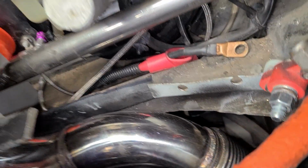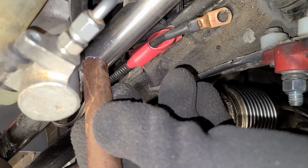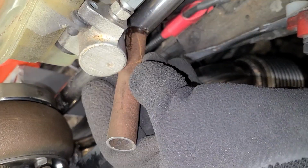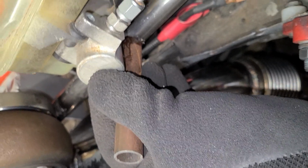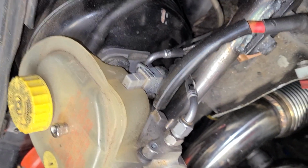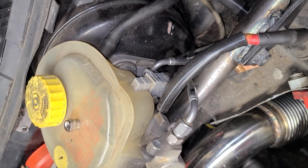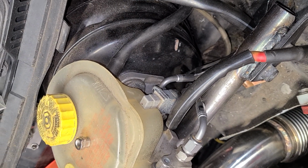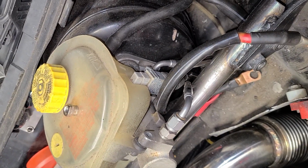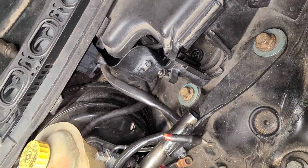And then I realized while I was at it, since the brake booster tends to flex a lot on this car, you know me already, I'm going to weld a tube here, flatten the front of this, and make a stop like the Subaru Cusco version. So it will brace here in the front and weld to the beam so the brake booster can't flex. Because I saw this on Shitsubishi when he was backing up his car at Englishtown before they closed the last drag racing time, and I saw how his firewall was flexing with the brake booster. Either Englishtown or Atco, one of the two. I saw it in another friend's car too. So yeah, your brake booster on the B5 or A4, they flex.